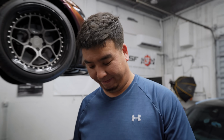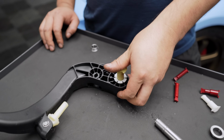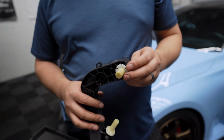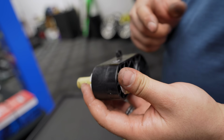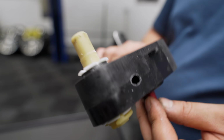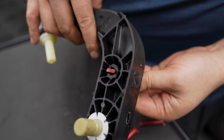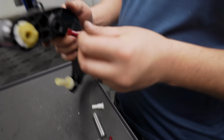This guy came to the rescue because things got a little bit complicated. This is the pin that goes in your clutch pedal. If it sits like this, then this pin would be on this side and it connects to the pedal assembly. So this goes in here like so, but there's obviously a bracket here that's connected. There's a spring up here, and this is where this pin would go for the slave cylinder. And the way it inserts is actually like this, and then you have to turn it. And it locks it into place? Yep. So yeah, this pin would be here.